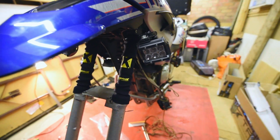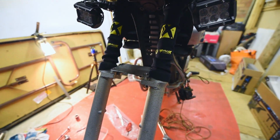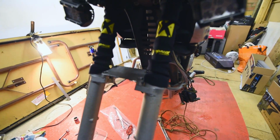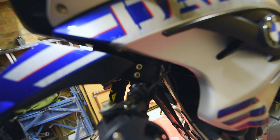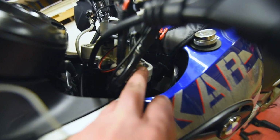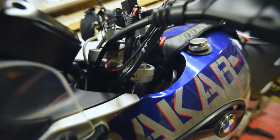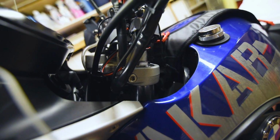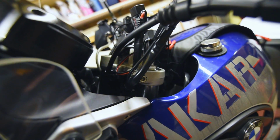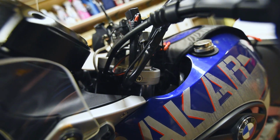So right, okay, we've put it a bit back together. Put the bridge across. Done the bolts up properly. Got that to line up to themselves. And then clamped it in place here. Forks level, top of the fork level with the yoke. Got that, then clamped them in place down here. Then done up the big nut nice and tight. Same on both sides. Torqued it up to the correct torque settings.